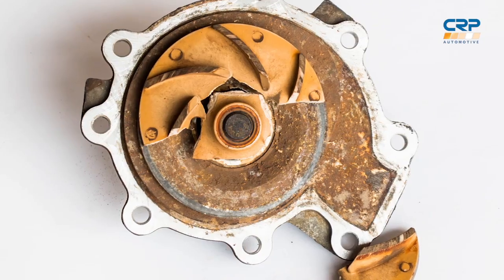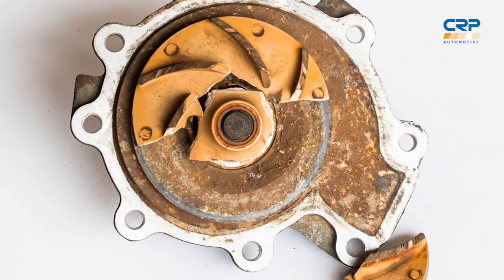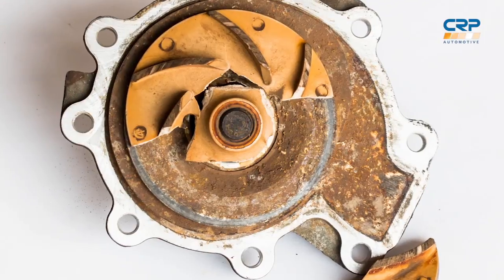However, the science has evolved and now we'd like to say that professional repair technicians are well educated and up to speed on the science of water. They prefer deionized water but will use distilled water when DI water is not available. Over the years, we've seen the damage that tap water can cause on water pumps and heat exchangers. Since heavy contamination and rusting can take over a year to show its effects, most mechanics did not initially link these failures to the tap water.